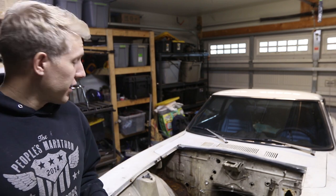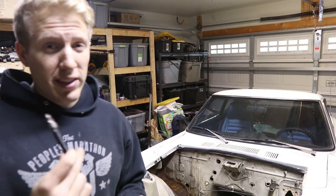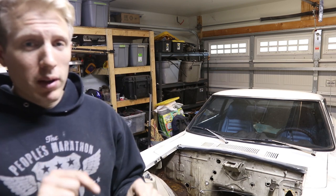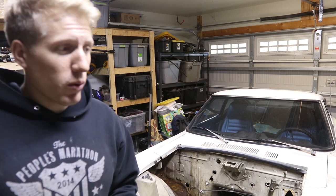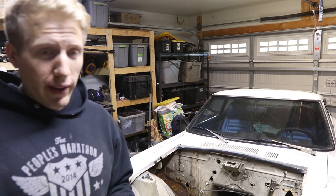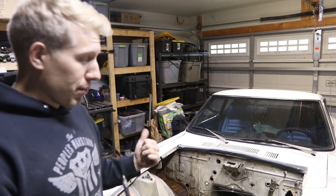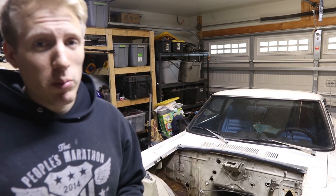I also filmed a whole bunch on removing it - whatever, it's not that complicated. All I did was I used a spot weld cutter - these I got on Amazon. I've used a few different brands and I think these are the best. They work a lot better than the Eastwood ones. With the Eastwood ones I was actually having to drill a pilot hole first, but I don't have to do that at all with these. They work really well - honestly too well, and I ended up putting a hole through sheet metal that I wasn't supposed to, so that's something I'll have to patch. But we've got plenty of patching to do anyway, so we've got to start hacking that up and making a replacement piece.